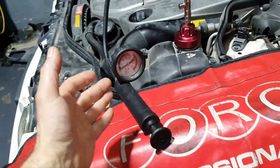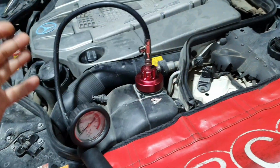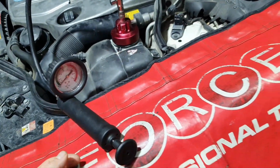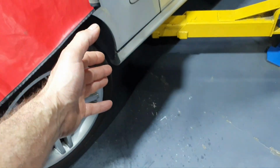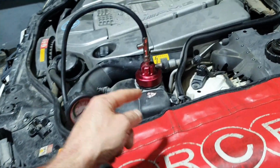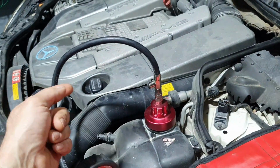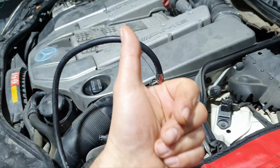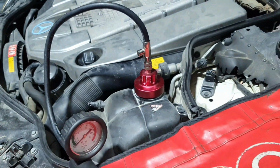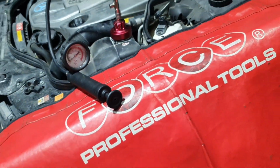Step 2. Leak tester for the radiator, alright. Then since it's cold, I'm gonna raise it up to 15 psi, 1 bar. I drained the oil and I'm not running the engine. So whatever coolant enters the engine is going to come out as coolant. You're not gonna have the chance to mix with the oil, because no heat, no vibrations, no pressure, no nothing. Makes sense to you? Let's pressurize it to see what's gonna happen.